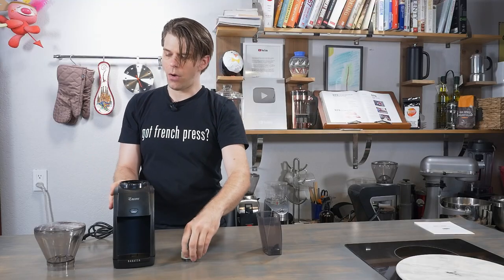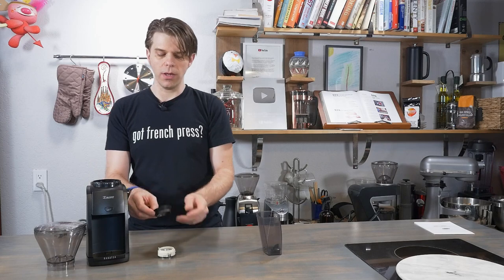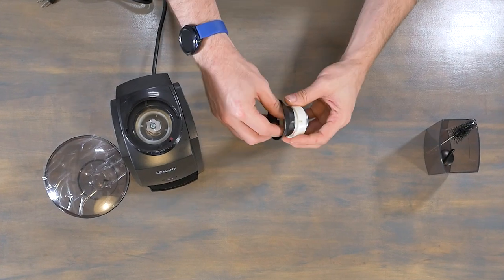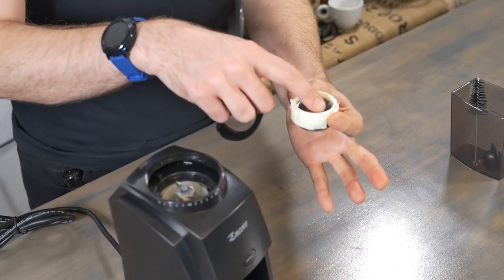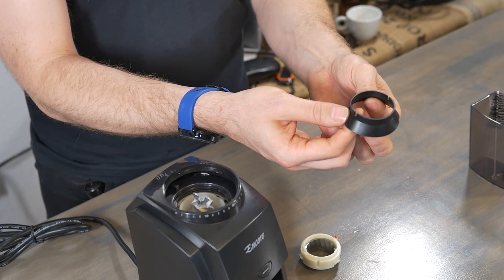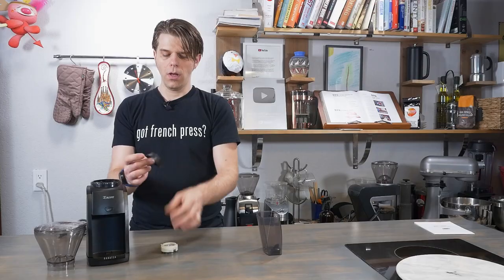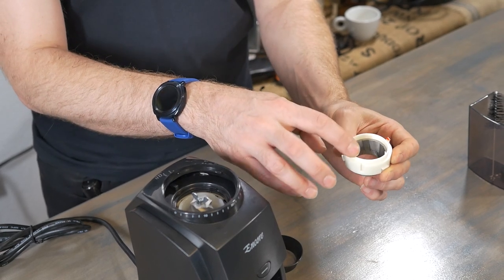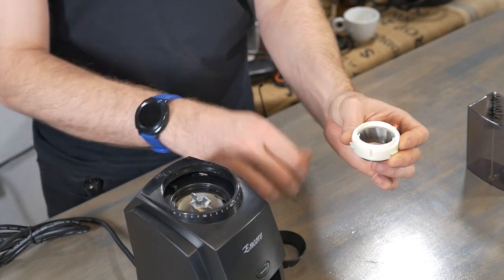I'm going to show you how to place this gasket with the inner burr taken out — it just slides right out, it doesn't screw in or anything like that, it just sits right inside of the Encore and the red mark on the inner burr lines up with the red line. I'll show you how to do this with it out first, but then I'll show you how you're probably going to do it, which is with that burr inside the unit. The rubber gasket likes to slip off fairly easily from this inner burr. You'll notice on the gasket you have two notches, and these two notches line up with that same red mark and the identical plastic wing on the other side.